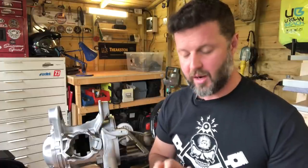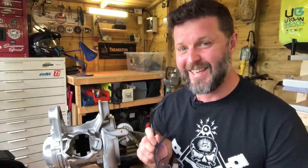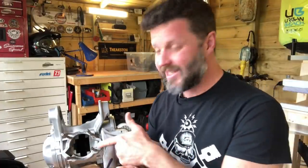I assumed perhaps this is something to do with the fact that this is a small engine in a low state of tune. So Daryl says, well, I've done a similar test - this time on an RB250 - taking his choice of pipe, carb, cylinder head compression ratios, squish, jetting, all the rest of it, done his porting work, got the thing up to 43 horsepower. Now this is 43 horsepower on a standard untouched casing - not matched, not flowed, not widened, nothing. And on every big engine I ever built, if I was doing it on a standard casing, I would have been reaming all these bits out.